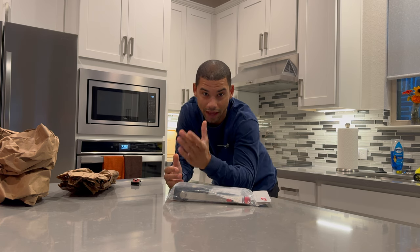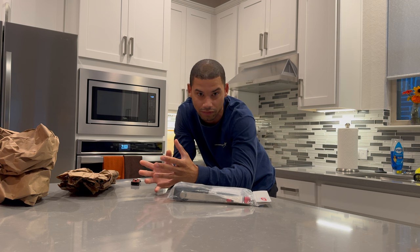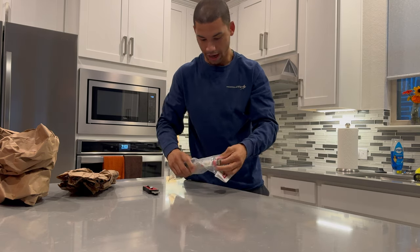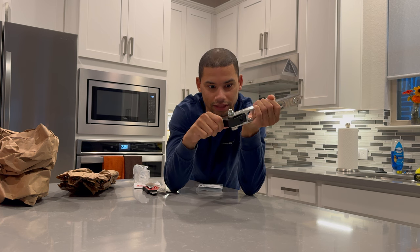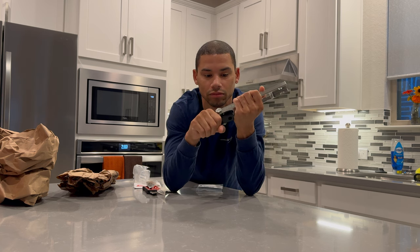I've been thinking: since I have the engine and trans mount from 034 and the subframe from Berkline, I have everything locked down in terms of engine movement besides this arm. The factory arm, which we're about to pull off, has a rubber bushing in there. This APR one is a spherical bushing, like the rest of my suspension. And this is serviceable — it's replaceable. You can hit up APR and get it replaced if you need.